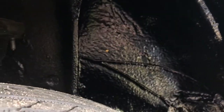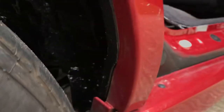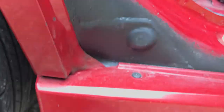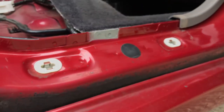Coming inside here, you can hopefully see all the arch has been prepared and replaced. It's all been well treated with stone chip primer, stone chip paint, and it's all been done. The outer seals are done, and there was a huge piece of rust up here as well — it's all been cut out and re-plated. Underneath is a plastic cover all the way along. All the outer seals have been done, and you can see where the overspray is on the stone chip paint.